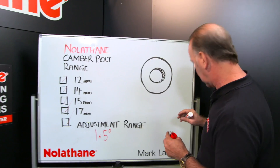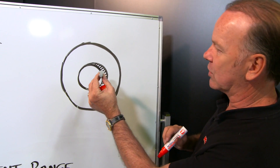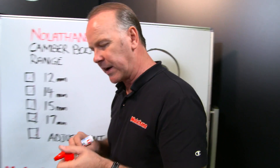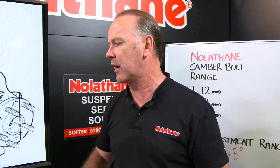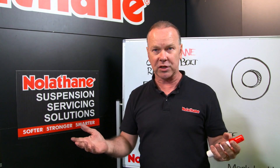Come and have a look at my picture here — you can see if you look at that bolt from the end all the way up, you can see it's kind of offset. Now, why do you need camber adjustment bolts? For many, many years vehicle manufacturers have been making cars adjustable in terms of camber. But in more recent times a lot of manufacturers have stopped doing that, particularly imported cars. And I don't believe that's a particularly good thing.